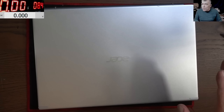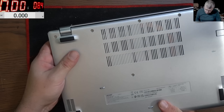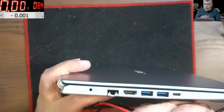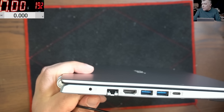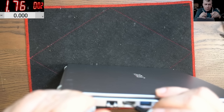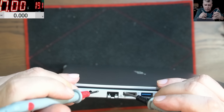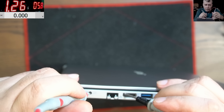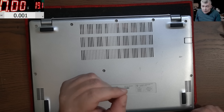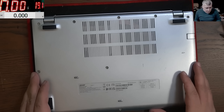I have the customer charger here but let's try with the power supply because with the charger we can't see anything. I'm assuming it's 19 volts - yes, 19 volts. We have the charging port here. Coming in with the 19V power supply at around 2 amps - ground and the middle pin - it does spark. The laptop is shorted, and this short is here, not after the first two MOSFETs. The short is on the charging port because it sparks.